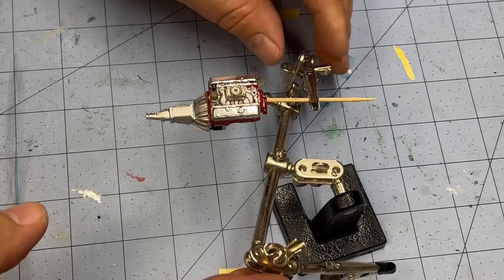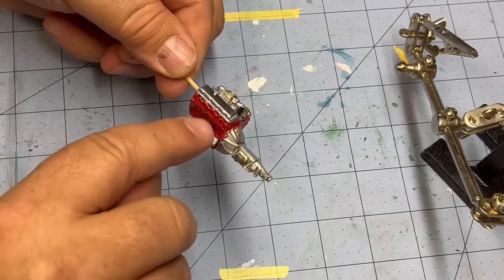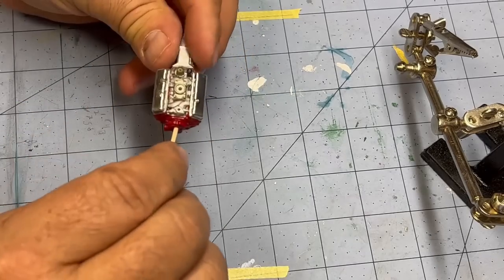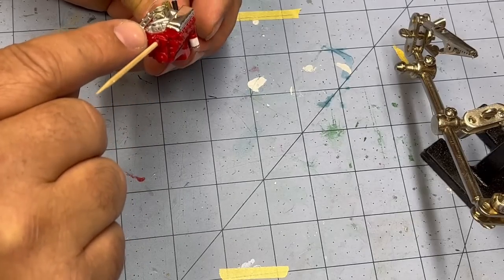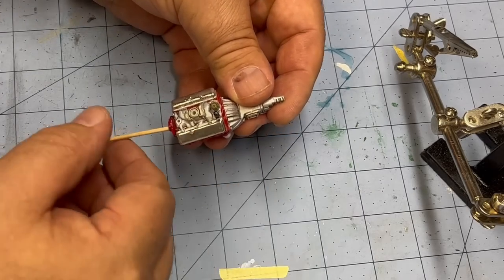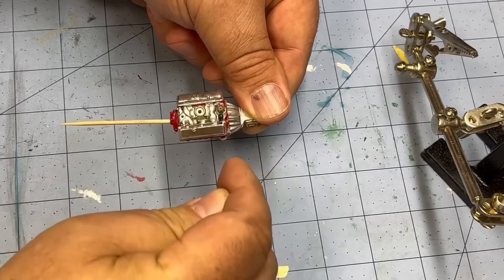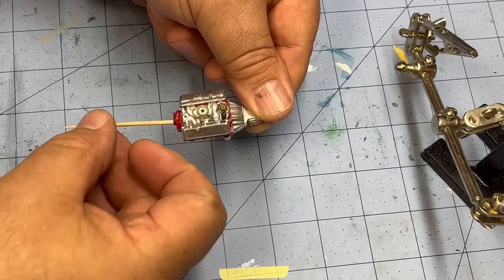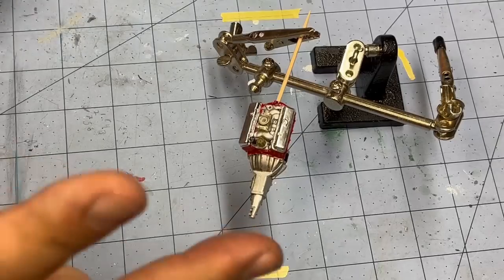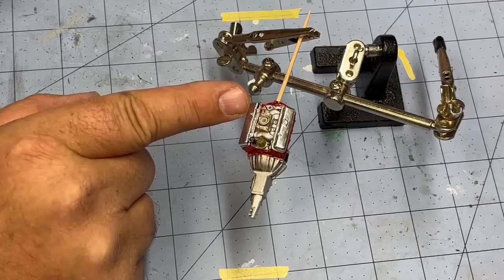Welcome back — as you can see on the engine, I've got a lot more built. I love this — everything's put together on it basically. I drilled the holes for the spark plugs on both sides, a hole for my heater hose bypass off the intake, the heater hose coming out of the radiator, holes for the positive crankcase ventilators on both sides, and a hole in the top of the coil. I have two more important things to do before I lay in the spark plugs.